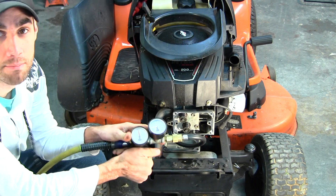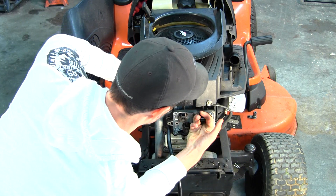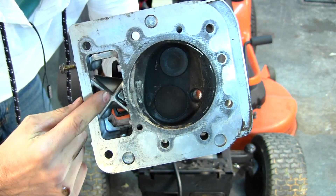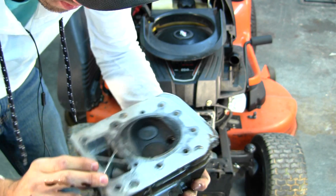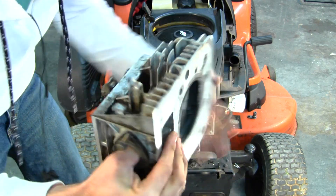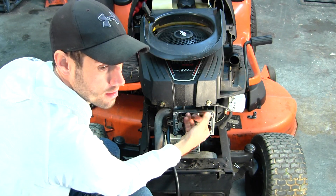I'm going to turn this down because I don't need it blasting that much air — I just need enough to hear where it's leaking. If I stick my finger in here, you can see this tube up inside — there's a hole up here and a hole here. It's actually leaking right in behind this tube. This is actually your intake — your carburetor bolts to here. So it's leaking right through here, and we're looking at it from the front. I'm trying to reach my finger around the back to feel where it's leaking out.